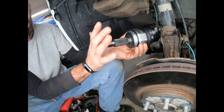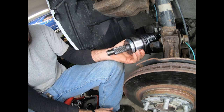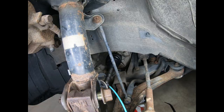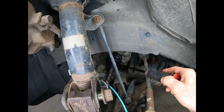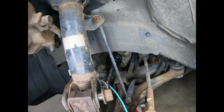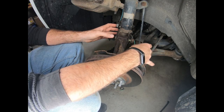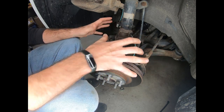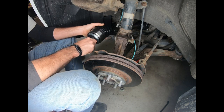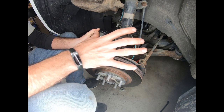If you don't have a brass hammer, just be really careful, or have someone hold a piece of wood there so you can give it a good thwack and get it in there without damaging the threads. Now that we have the new axle seated in there, I'm going to clean up any excess transmission fluid in this area just to make sure it's good and clean and I can double-check for leaks before continuing to reassemble everything else. The next step will be to remove this support bolt, being very careful of your vehicle speed sensor wire. Pull this bolt out, separate the two parts, angle it and get it lined up with your bearing and spindle, slide it in, and then reassemble.